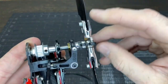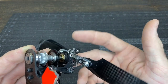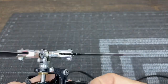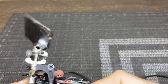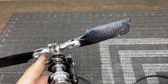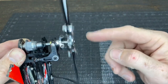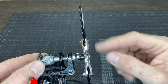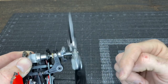At the tail head, check the tail gear teeth and slowly spin the tail to feel for gritty bearings or hard spots — the tail spins very smoothly here. Check the mixer arm bell crank for any breakage; it feels good and smooth. However, the pitch slider is found to be broken and will need to be replaced. Now spin the tail shaft to check for bends; no wobble is visible here, so the tail shaft survived.